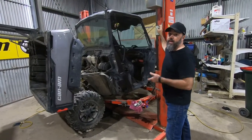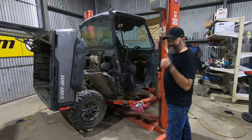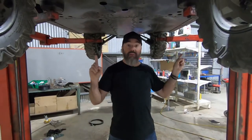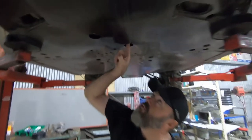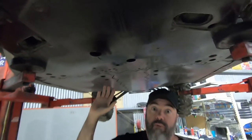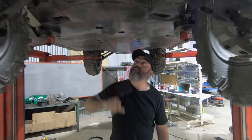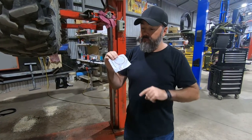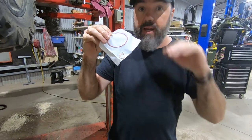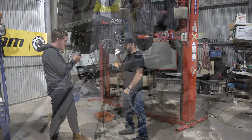Next we're going to check underneath the machine and drain the oil. Normally you'd be on the floor of your workshop, but if you've got a hoist, happy days. The sump plug for the engine is right here, and the genuine bash plates have a hole in them so you don't have to remove them — which is great because they're riveted on anyway. Undo the plug, make sure you've got a tray underneath you and get out of the way. Remember to check what year machine you've got, as you'll need the correct crush washer for the sump plug when you put it back in. Once it's fully drained, fit the correct crush washer and reinstall the plug, then lower the machine back down.